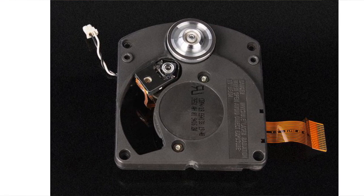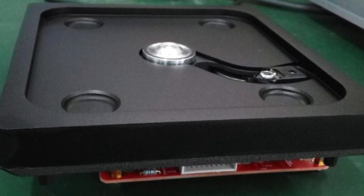It's 2019 — what is the future of CDs? I think CDs as a format are going to be around for a while. But with high-end CD players, there's always a question about the laser mechanism itself — it's not forever. It's an electromechanical device and they do wear out. The good news about this Jay's Transport is that the laser is actually user-replaceable. The laser itself sells for $100, and the entire laser mechanism as a plug-in piece sells for $300. I think that adds comfort — this is the kind of product you can own for a very long time without worrying that the laser's going to crap out.